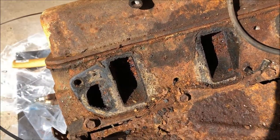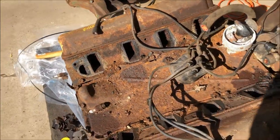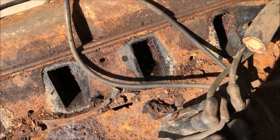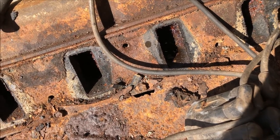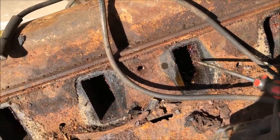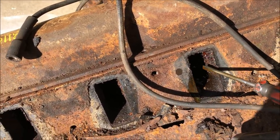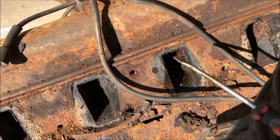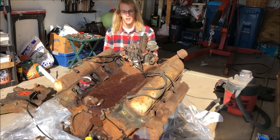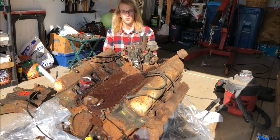They're enormous. The first observation I'm going to make is that I think somebody has tried to get this engine running before. This one cylinder appears to be pooled up with oil - either ATF or Marvel Mystery Oil. But it's sealed, so I guess that's good. I just filled all the intake ports and the cylinders with Marvel Mystery Oil.